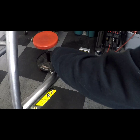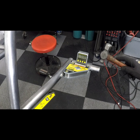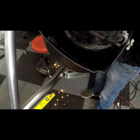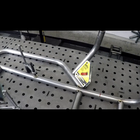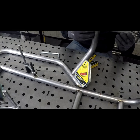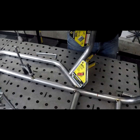Here we're just leveling out the foot peg — same as the left side. Once you get that done, just go ahead and tack it in place. Onto our final step, which is installing the handbrake mount. I advise you to put this on the left side — it doesn't matter if you're right-handed or left-handed. The reason why is the throttle cable is usually located on the right-hand side. So you want to be able to drift around corners while pulling the handbrake and pushing through the throttle. It's really hard to do if you have the handbrake mount on the right side and the throttle on the right side, so just keep that in mind.